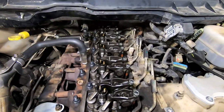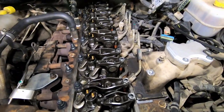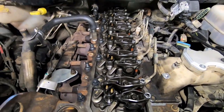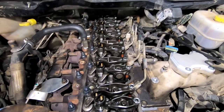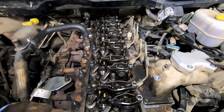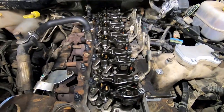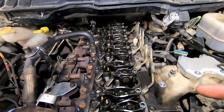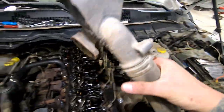All valves are adjusted to spec. Personally I'm going to crank the engine over a few times with my ratchet on the crankshaft pulley, then set to TDC 1 and check valve lash again, then rotate 360 degrees and check at TDC 6 — because sometimes after cranking the engine over a little bit they'll loosen up. I'm glad I did that because a few of them had loosened up. Now grab the upper rad hose. I always recommend using a new thermostat when you're doing a head gasket, so I'll get the new thermostat in there.